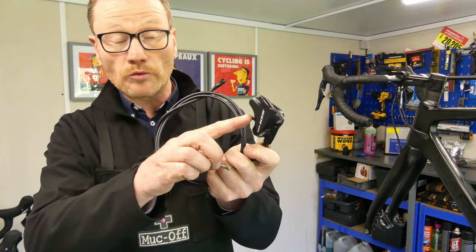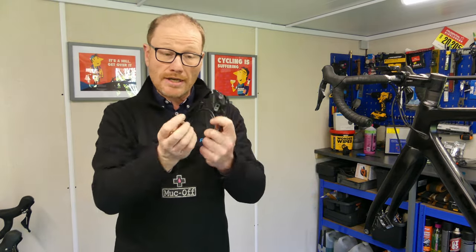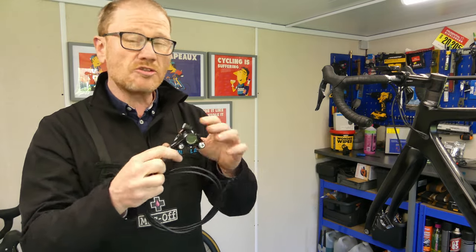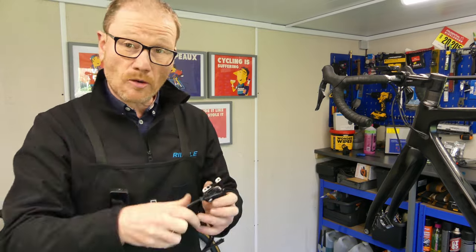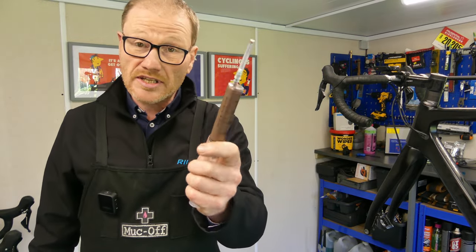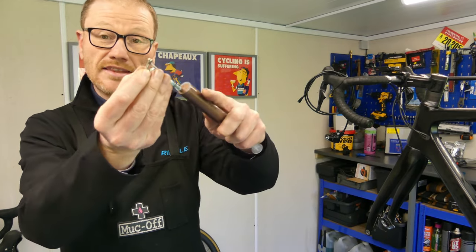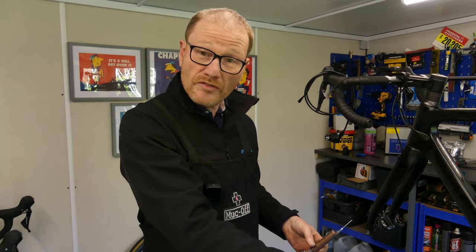While putting the brakes back together, here's a quick tip: the brake caliper body is alloy, and the retaining bolt is steel. When you bolt steel and alloy together with a little moisture over time, you get galvanic corrosion where the two freeze together. Experienced bike mechanics will tell you the nightmares of these being frozen in. Simple fix: get some copper slip or copper grease, add a tiny bit onto the end of the bolt, and you can be confident it will come out next time.